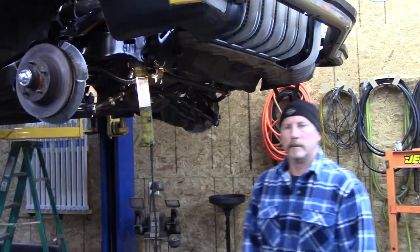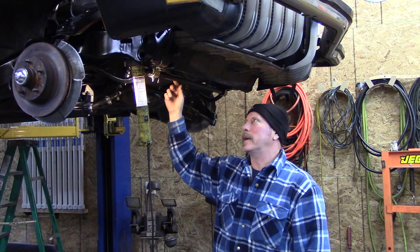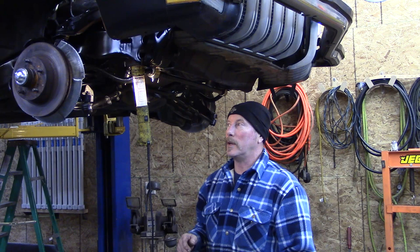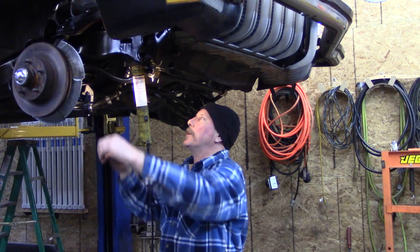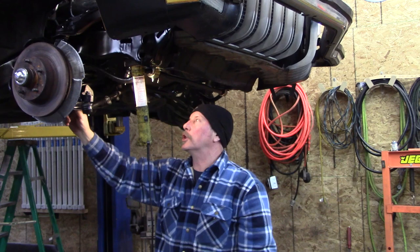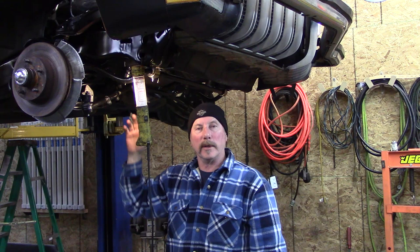I've worked on other cars in the past wanting to improve handling — went to fatter sway bars, wanted to use urethane end links too. When you're by yourself on the ground it's pretty difficult. He and I had it up on the lift, and it always seems like they don't give you enough thread on the bolts. He ended up putting a piece of wood through and prying down so I could get a thread started. The bushings aren't tight against the control arms at first, but by the time you get everything tight this thing is really torqued up — it's actually putting a preload on the suspension. We're going to put this back together and drop it down to see if it pulled the front end down a little.